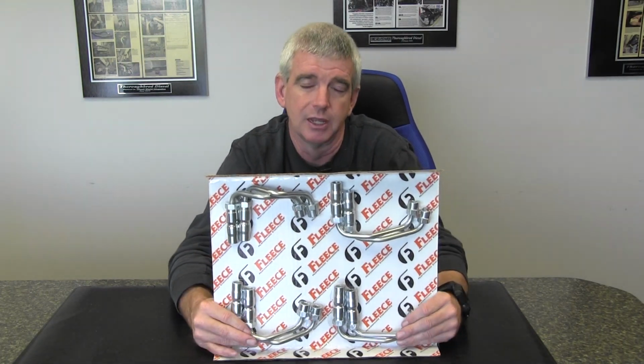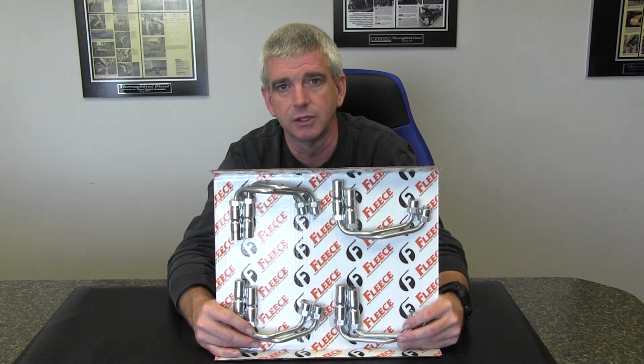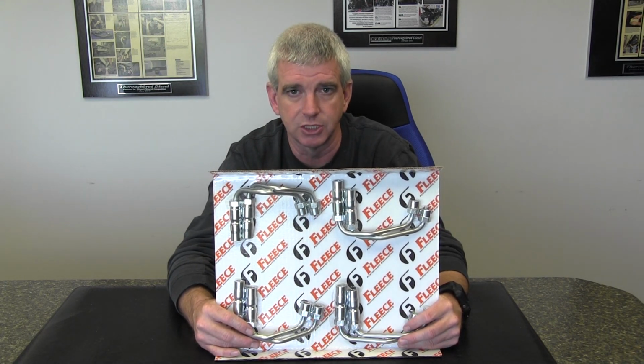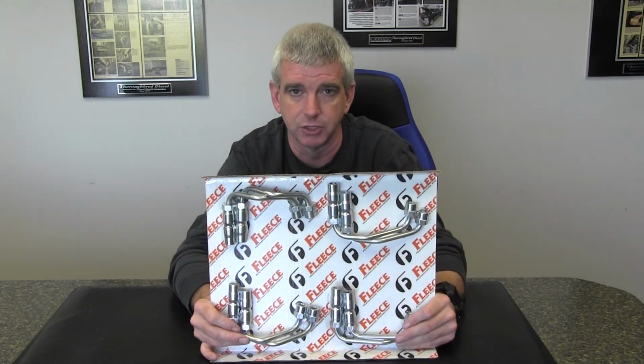When you're working in common rail injection systems, cleanliness is key to a good install and the overall health of the injection system. And one of the first steps that you can take to cleanliness of the installation is to install new high pressure fuel injection lines.